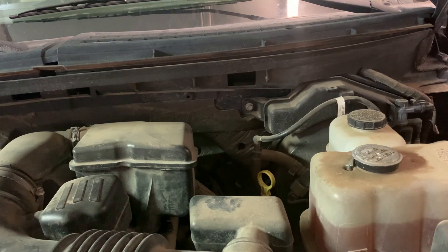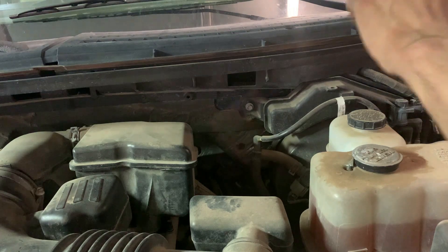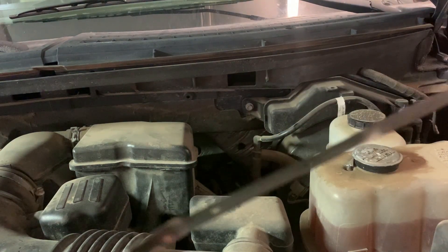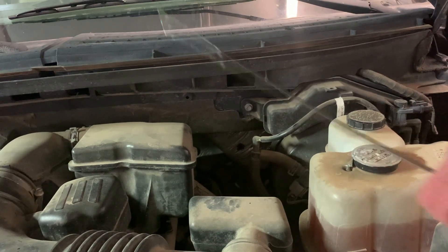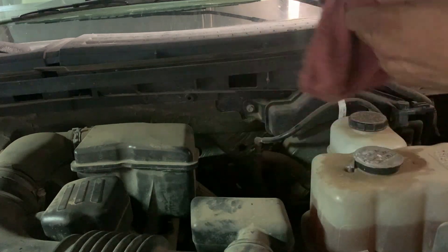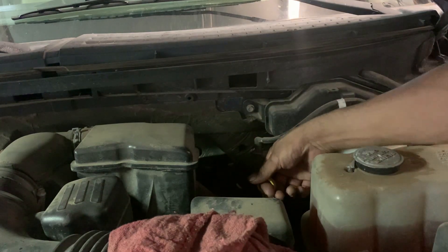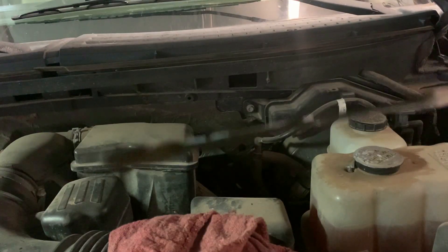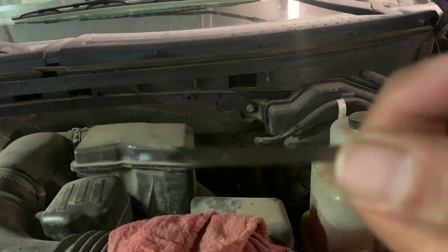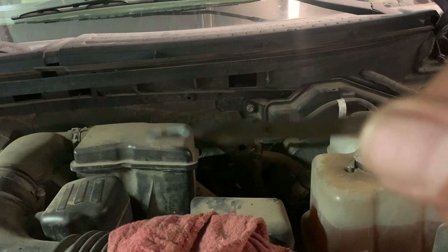My lighting isn't great. Don't take the first reading — wipe it clean, and this is the one that counts. Here we go, drum roll. I'm blind as a bat so I'm going to look at it in the light. Dang it, that dude was right — still needs another quart. Okay, let's check it again — we've got seven quarts in there now. Okay, we're good — it does take seven quarts. We're right here just a little bit below the crosshatch marks, so we're good.